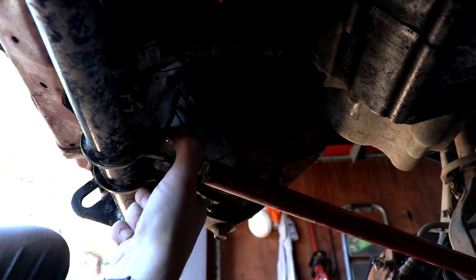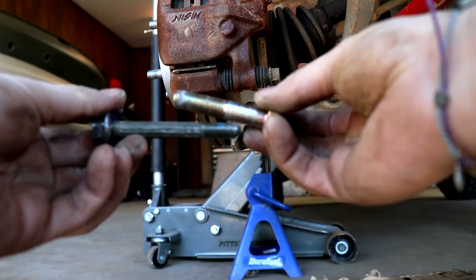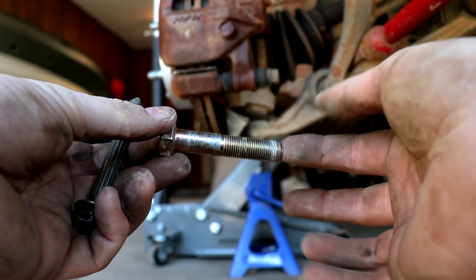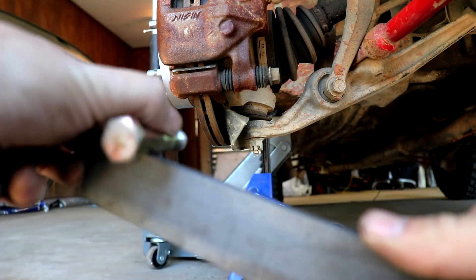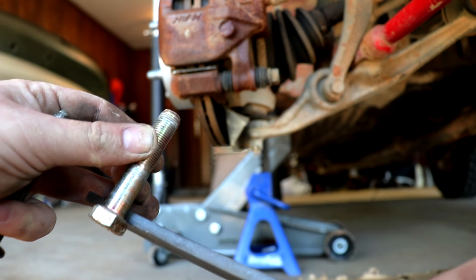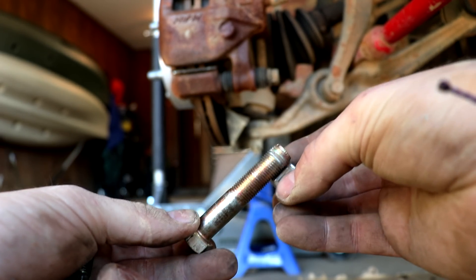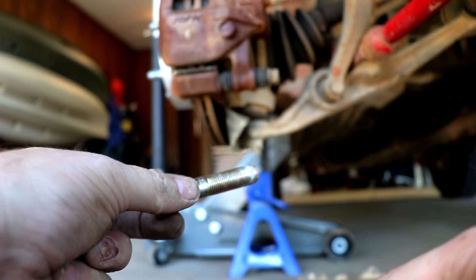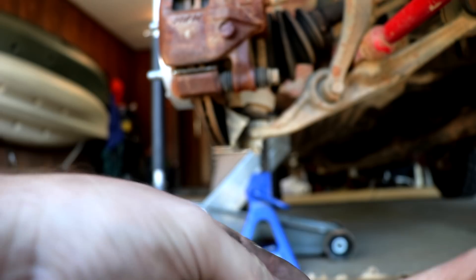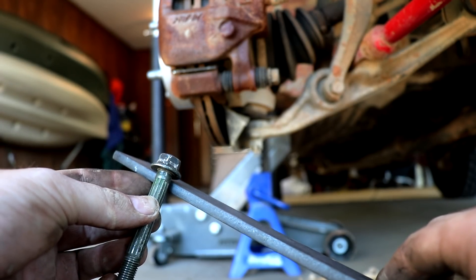So basically the back side of the plate will be there. For the front side I think I want to mount it here off of this traction bar — that'll give me a nice segue so the skid plate doesn't get caught on anything. This will be the lowest point and it'll just bounce and hit the skid plate and go across. I want to put this quarter-inch steel plate and make a bracket that comes off the top and bottom of those bolts. I need these to be at least a quarter- to half-inch longer because there aren't many threads poking out the top of that locknut, and I don't want to risk engaging fewer threads and making it weaker. I'll find a higher-grade bolt for the traction bar and the lower control arm so I can put a washer stack and a quarter-inch bracket plate for a drop-down mount to the top of my skid plate.